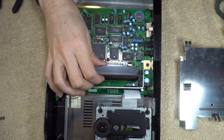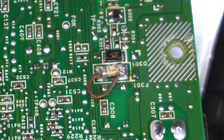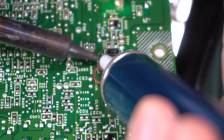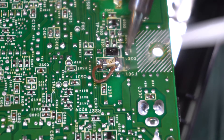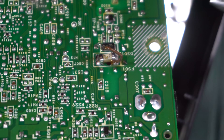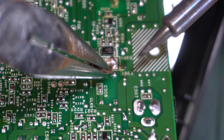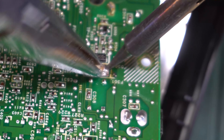While I was in there, I did some de-dusting with the blower. There on the back you can see the bypass I made — that white thing there is the fuse that was, I think, original to the system. You might say that's dangerous, but it's actually not in my setup because I have a switch for every single thing, which helps protect the Sega CD from surges. At that time I didn't have enough skill or confidence to change that fuse out, and I probably would have had trouble finding the right fuse. But either way, I'm going to remove this bypass and remove the old fuse and put in a new fuse.